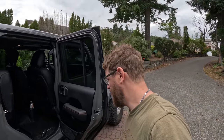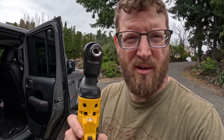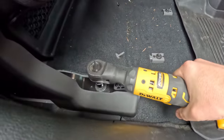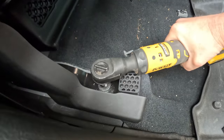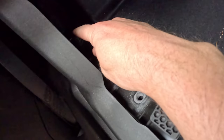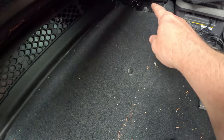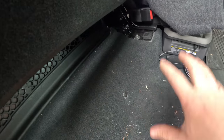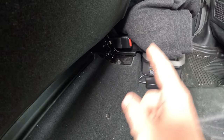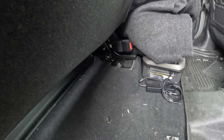Let's pull the back seat out — it's pretty straightforward, four or six bolts per side. In the newer models they've switched from Torx to E-Torx, so this is a 14mm E-Torx which you're going to need to remove these funny-looking bolts. There's one here, here, and then two more over there. If you've already removed the plastic like I have, that's all you'll need — otherwise there's a plastic piece holding the two seats together, and then four more bolts on the other side.